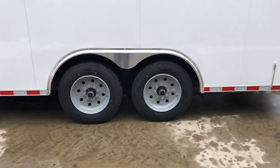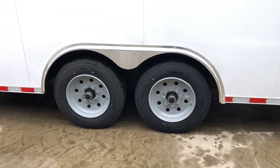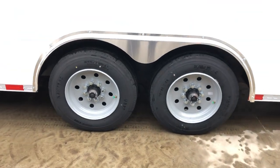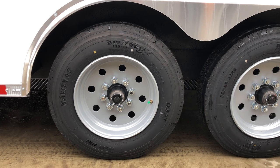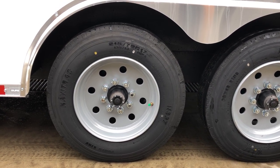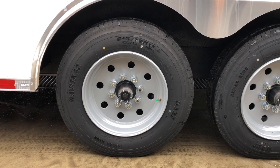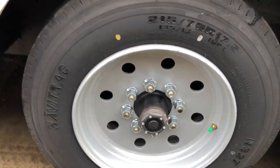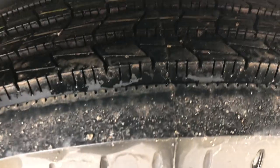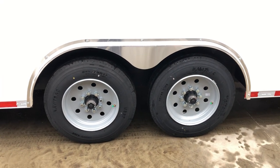With the 8K axles, a couple of things. This has the full-size brake drums. What I mean by full-size: you can either do a 2-1/4-inch like what's on a 5, 6, and 7K axle, or you can go to a 3-3/8-inch like what's on a 10K tandem trailer. This has the larger brakes. Also, on an 8K axle you can go to either a 14-ply tire on a 16-inch wheel, or you can go to a 17.5, which has a solid or mod-style wheel. It's a heavy-duty wheel assembly with a 17.5 tire with 16-ply rubber. Net effect: this is a 4,800-pound-rated tire, a little heavier than the 4,000-pound tire that would be required — much more durable and has about twice the tread. You've got about 19,200 pounds of tire on this setup, even though it's only a 16,000-pound GVW trailer.